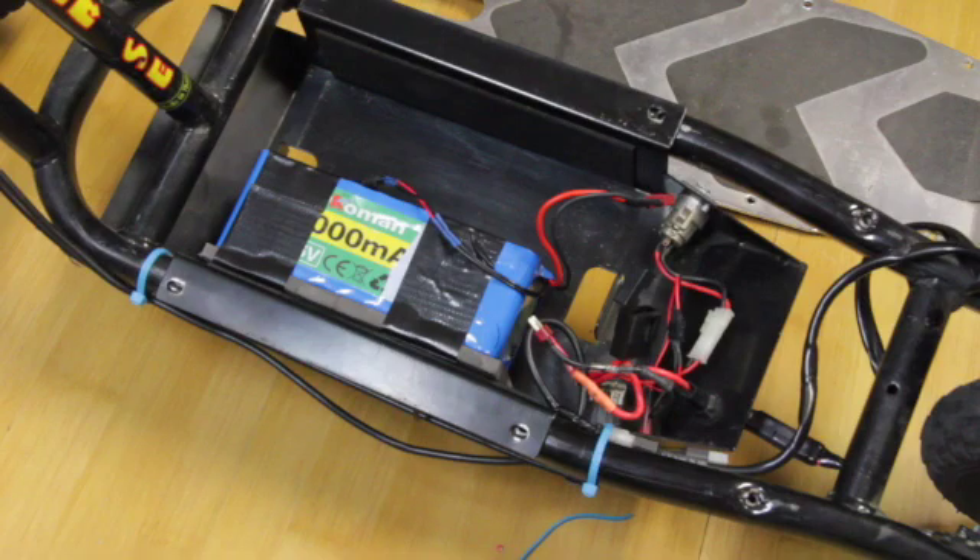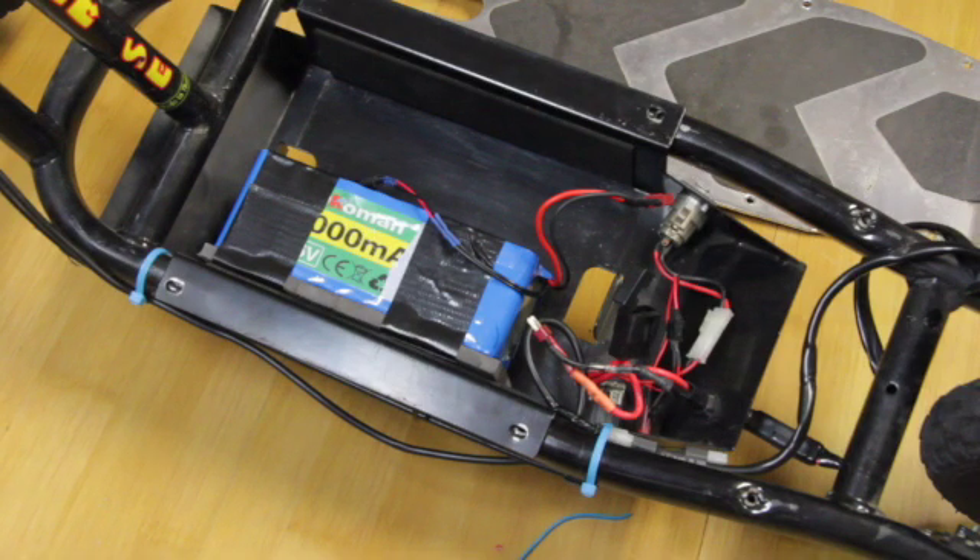We just got back from our ride. We have some good news and some bad news. The good news is we were able to do 24 miles per hour on the straightaways. The bad news is the motor stopped working halfway through the ride. I did some searching on the manufacturer's site — this motor is claimed to be capable of 24 volt, 36 volt, and 48 volt. I pulled the fuse out and the fuse is good, so chances are we probably fried the controller on the motor.